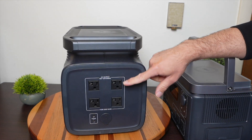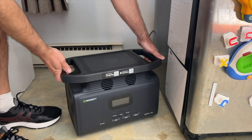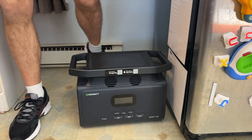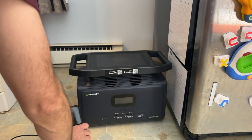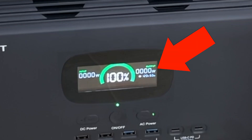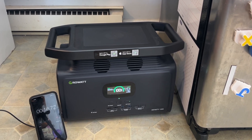One of my deciding factors is whether a unit can run my refrigerator or chest freezer during a power outage. Devices like a refrigerator have compressors that need a special amount of power for a fraction of a second to start up, then they don't need much after that. So make sure to check the surge power on the AC outlets. The Growatt 1300 has 1800 watts of continuous output and a surge power of 3600 watts — it's typical that surge is double the continuous value. When I hooked up my fridge, I saw the output spike from zero to over 2000 watts in one frame, then quickly settle to its normal 100–300 watt operating range. So for a full-size refrigerator, you can expect about 2000 watts of surge power needed to get it going.